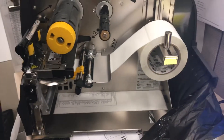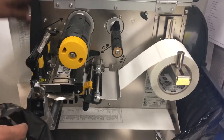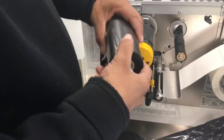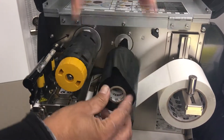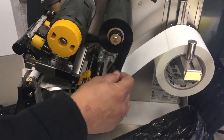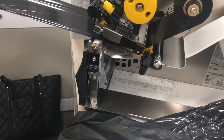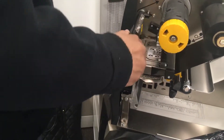So that's the labels. Now for the ribbon — we're going to start fresh. Break it. If you follow the diagram right here, it shows you that the ribbon goes like this. Slide it around the spindle and go underneath your printhead. Pull a good portion and lock it down.